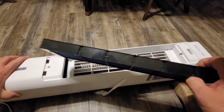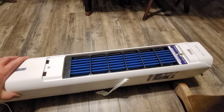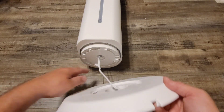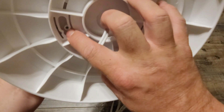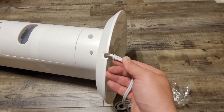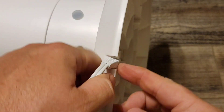The filter is a lot thinner than the other ones. You are able to put it in the dishwasher — it does say you can get it wet — and I read that you can also freeze it for best results. They recommend changing it every three to six months and washing it weekly. We stick our cord through the bottom of the fan; there's a little spot where the cord fits through. Then we align the tabbed spots and spin the base into place, and it clips in.